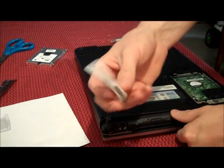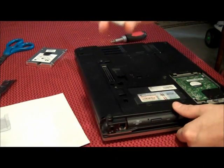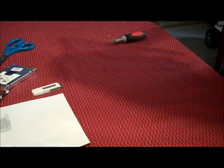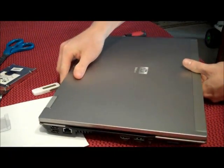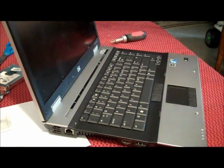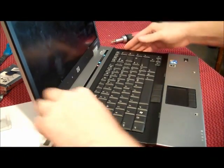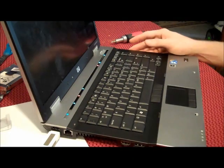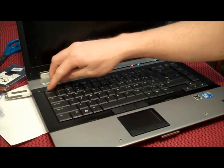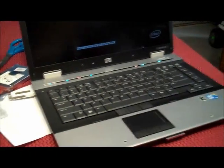On your thumb drive, you have to have it bootable. Whatever you want to make it bootable, do so for a thumb drive. Then you want to download a utility called HDDHACKR. If you Google that, you can get the bin files. It contains boot sectors for a hard drive. There's one for a 60 gig image, one for 120 gig, and one for 250 gig.